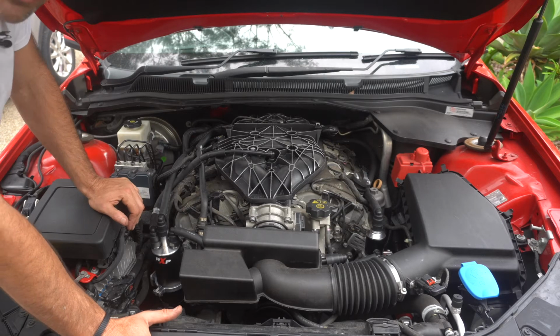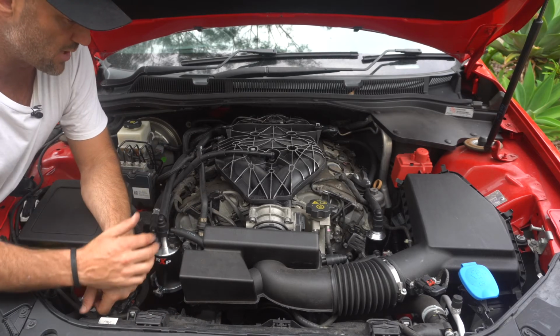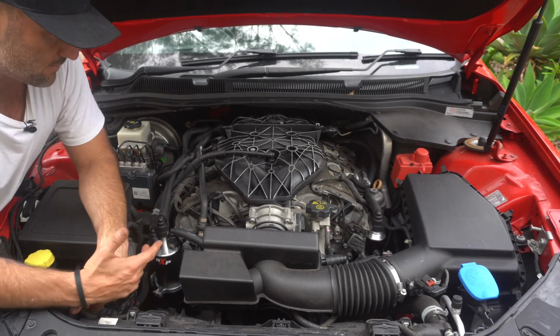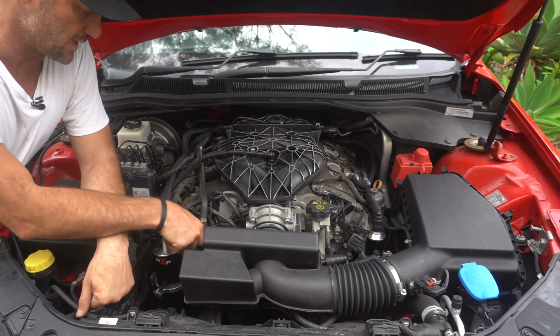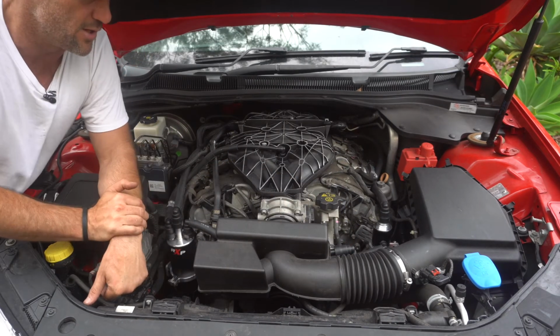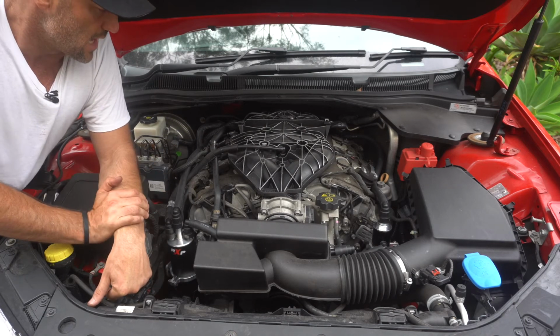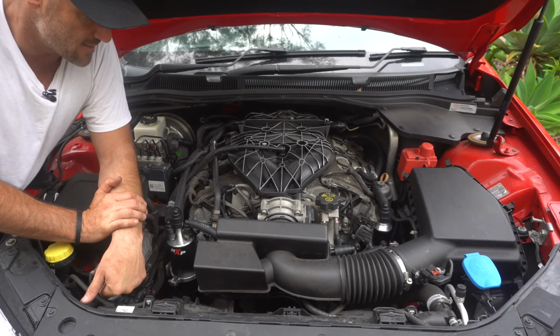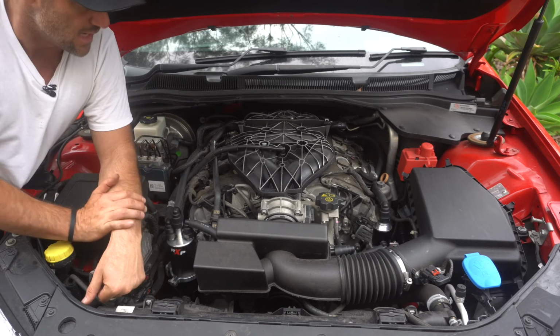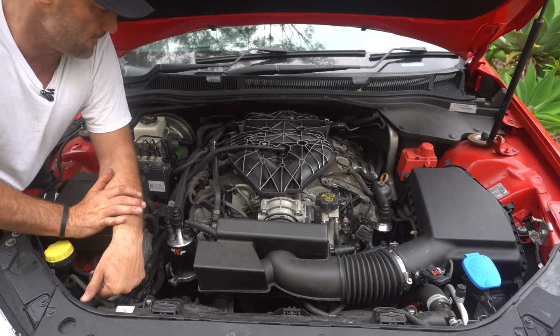Look, I would recommend these systems. I know there's a lot of plumbing involved. There's a lot of pipe, frankly, but I suppose the vacuum that's been pulled in here is almost like a Venturi effect. When the throttle's on, some areas are going to be higher vacuum pressure than others, and that second can sort of takes care of any overflow or any blowback that you might get.